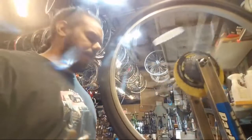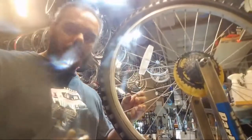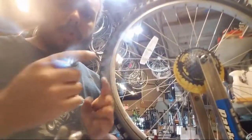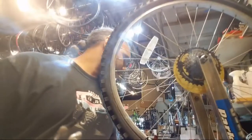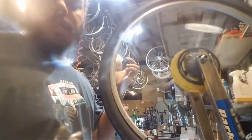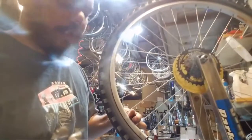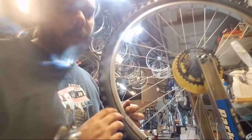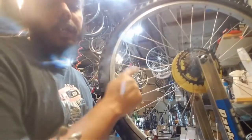And we spin again. So each time we spin, and it's hard to see on here, but there is a little handle down here and some calipers that I turn the handle to advance the calipers closer to the rim. So part of that is, it's a flat tire, so it's a little hard to tell exactly on the screen, but yes, this is probably an example of a wheel that can be trued one more time before it's time for a new wheel, or at least a new rim and new spokes.